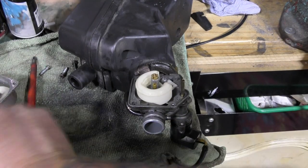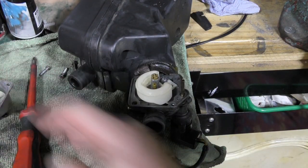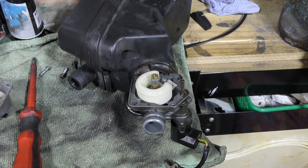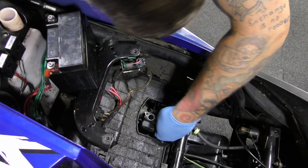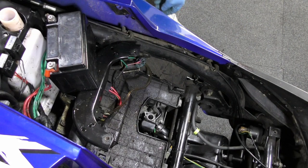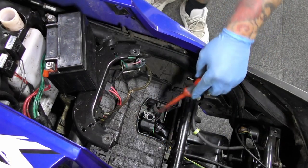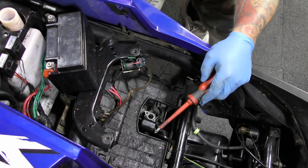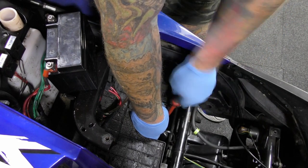New gasket in, here's the bowl of fuel — it's just topping over and coming back out, that's not right. I've done the airflow test and once it goes up it stops blowing through. Really starting to bug me. I'll take the damn thing off again. You've got to do things again and again sometimes. Make sure you line this up properly before you get it on — I mean the airbox — otherwise the airbox will stick out, so keep that loose and make sure the airbox goes on nicely.